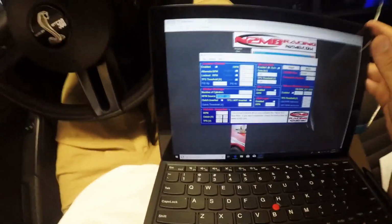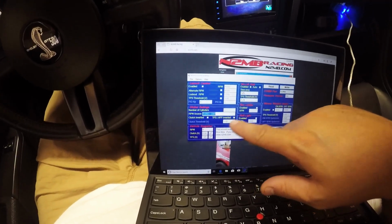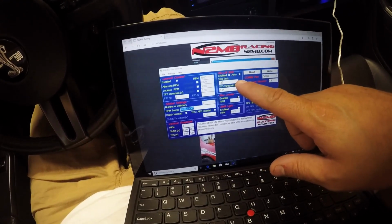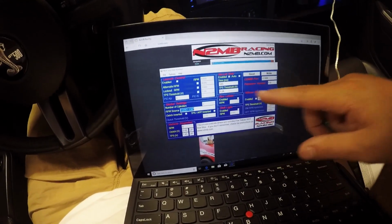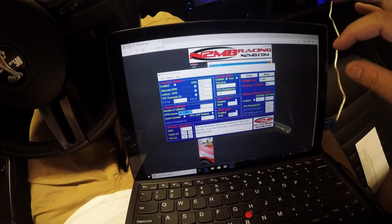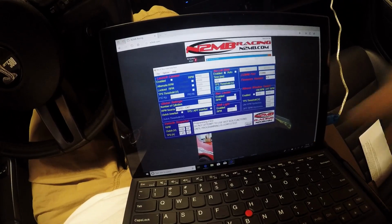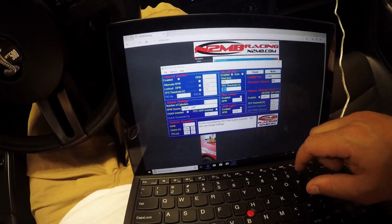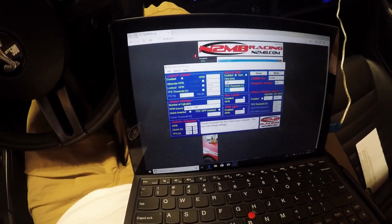All right, so if you can see that, I turned off the two-step, set it to Ford coil pack, 8 cylinders, and set the no lift shift to enabled, 125 milliseconds, 3.24, so around 70% it is going to hit. We're going to go ahead and do write, and it goes through the sequence. It's complete. So now everything should be set up.